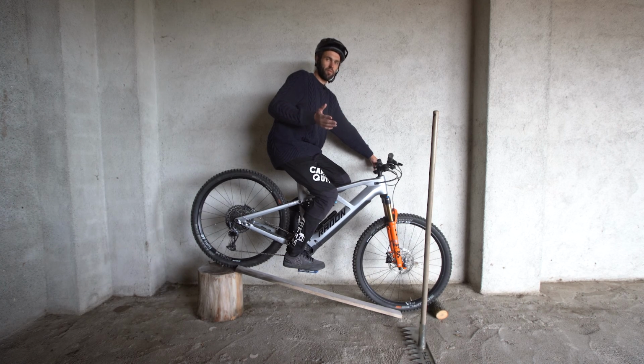Anywhere from 30 to 50mm is a good length. You don't want to be over 50. The extra large bike comes with a 60mm stem. And I think using a longer stem is an old-fashioned way from road biking and XC riding to fit the bike better to taller riders.